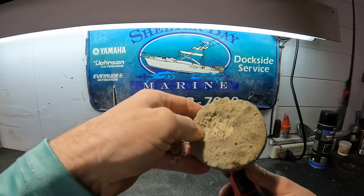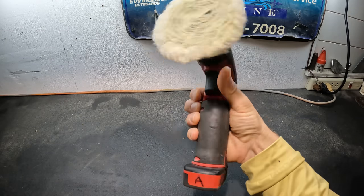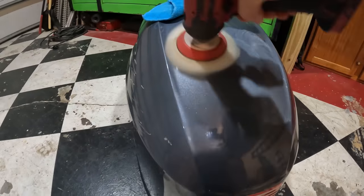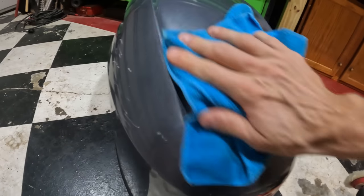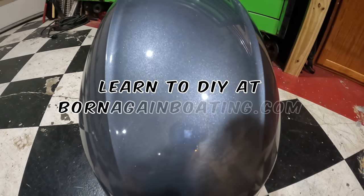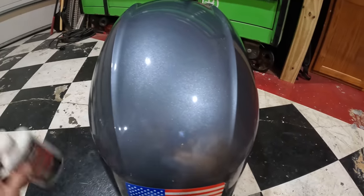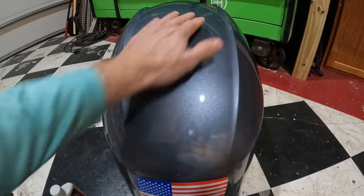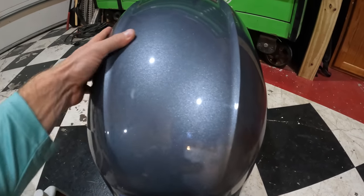For something more shot up, there's another way to do this — you'll need a polisher with a pad like this. Put some of the compound on there, put it on the cowling, and as you can see that has removed pretty much all of the minor scratches. Depending on how deep the scratches are, you can use more or less compound, or get different types of polishing pads to really cut through. By and large, a simple polisher and compound will take care of all your minor scratches.